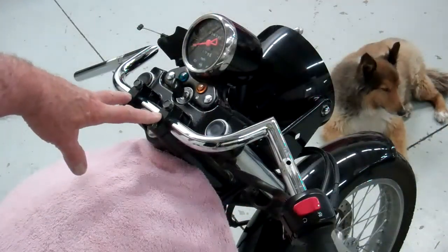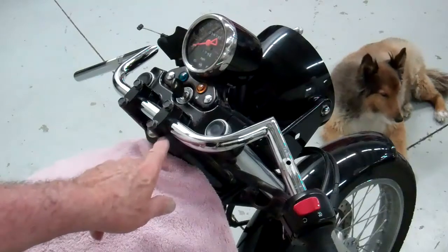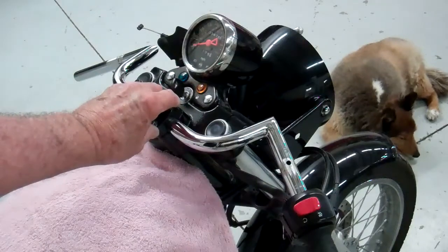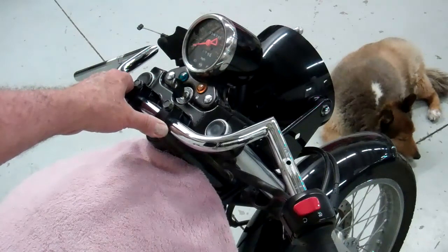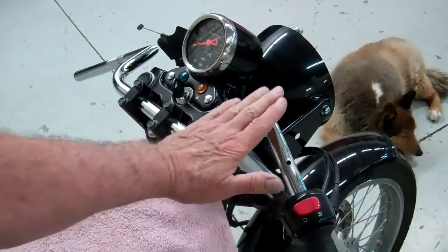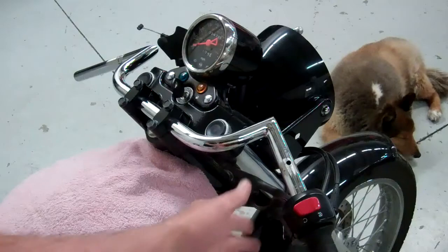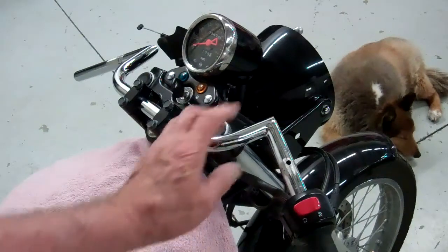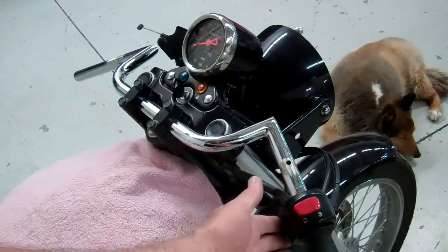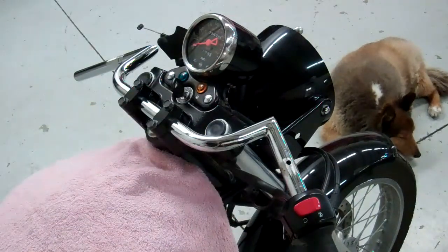I've temporarily clamped the bar on the bike. The most important thing on these clamps is to make sure there's an equal gap on each side — it's important to have the gaps because if one is touching when you tighten the other side, it won't clamp properly. Go ahead and snug those up. You want to have this bar forward and up a little bit because later we can drop it. But if it swings over, it might hit your tank. So adjust this angle after we get everything installed, because we don't want this to swing over and dent the tank.